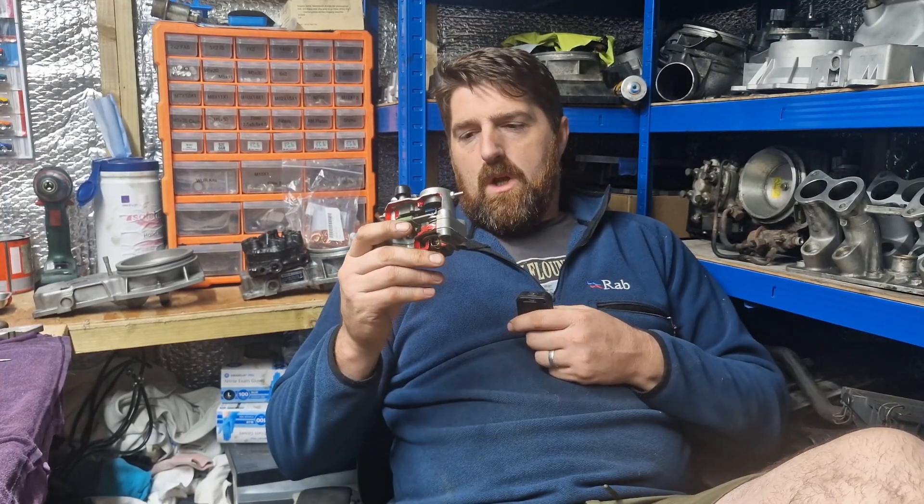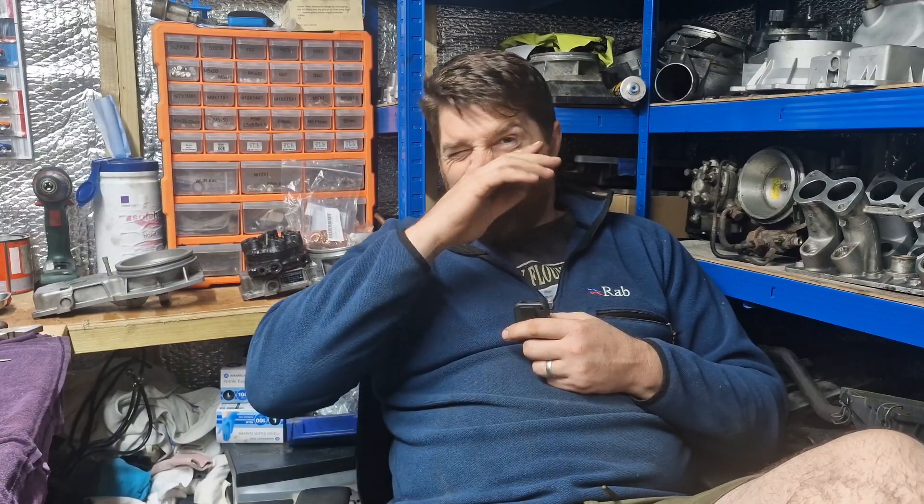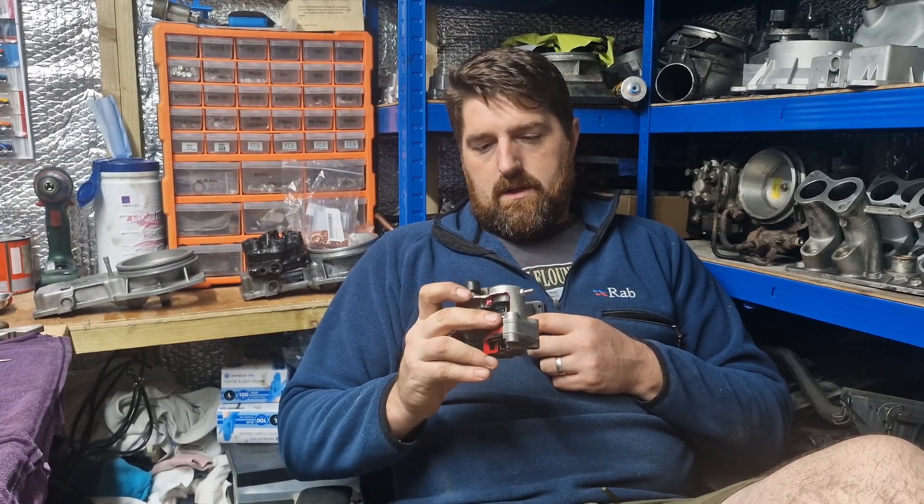My curiosity got the better of me and I thought, let's test that and find out. We thought we knew all we needed to know about the warm-up regulator, but one thing we didn't consider was voltage. What happens when voltage goes to the heating element in here? The heating element moves up and down with relevant temperature. 12 volts is what it needs to operate, but when a car's running — good battery, good alternator charging system — you haven't got 12 volts, you've got 14.5 volts, or between 13.5 and 14.7 volts. So how does that affect pressure? Quite a lot, actually.